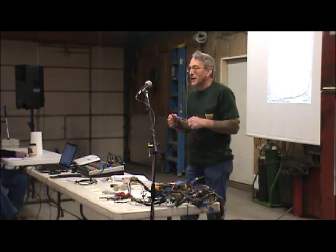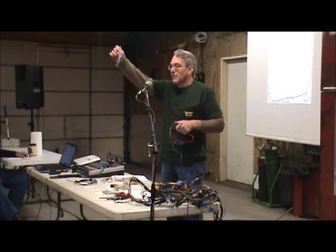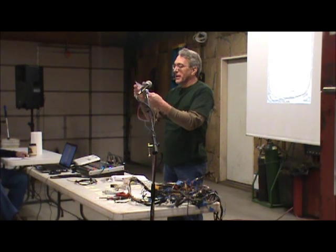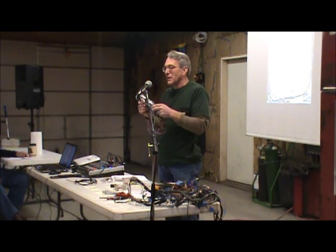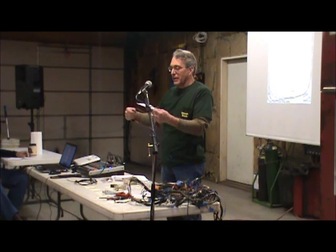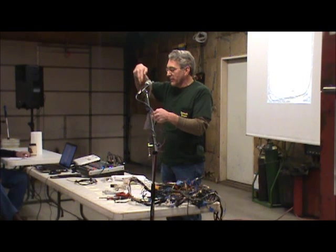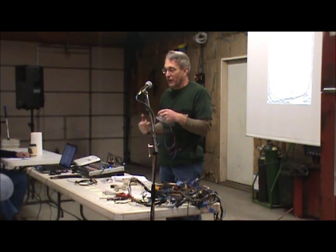How about solder it? Right. Solder it. Better yet, one of these. Yeah, one of these. This is an insulation displacement connector. Basically, it's a barrel connector with another barrel parallel to it, but that one doesn't go all the way through. And you clip the barrel onto the feeder and slide the tap into the other hole and squeeze the whole mess together. And there's a barb in there which actually forces the insulation apart and squeezes the wire into it. That will stay together forever.